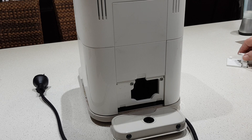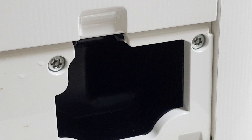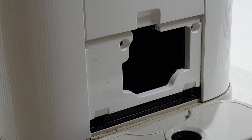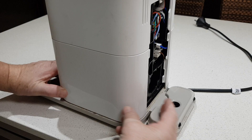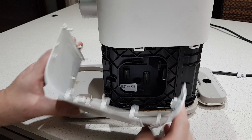Getting these apart is quite tricky. There's a little panel on the back — it's got the descaler adapter in there. You take that off and there's two screws. These are two special screws but you can buy adapters to fit them, available almost anywhere. So just remove those two screws. I'm doing this on my kitchen bench because there'll be water going around everywhere. With the two screws out, just push down and it'll come away from the top, and you can remove this panel.